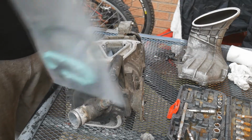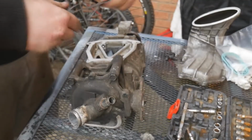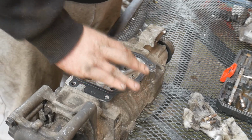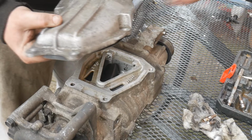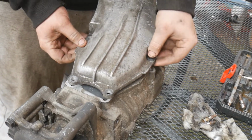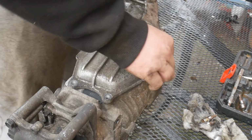As you can see, it's got top written on this gasket, so you know which way it has to go round. So we've got the gasket on now. We're going to place the horn on, and you might actually find it easier. Whack a bolt through the horn and through the gasket, and then from there line it up with the hole on the charger.